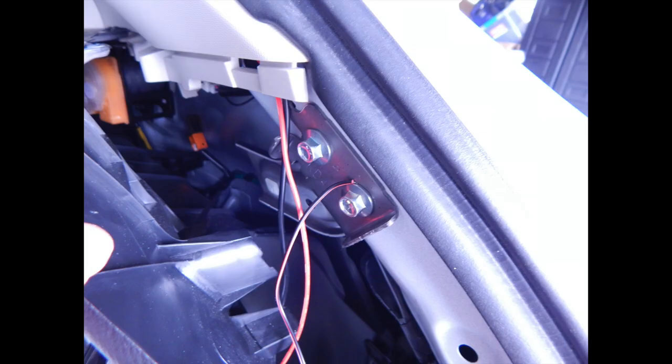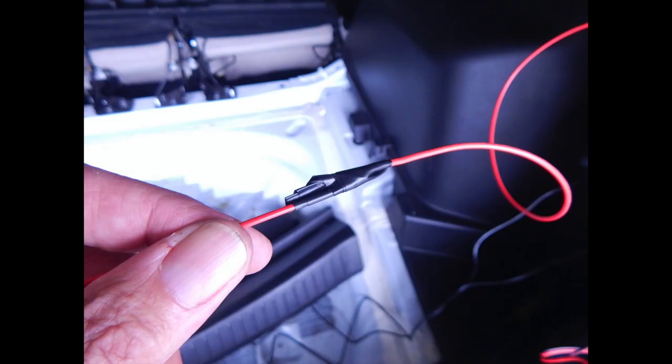You can see where I pulled the wires through that rubber grommet. It's a good idea to put a little silicone seal in there once you've run your wires. I attached the ground wire to the frame or chassis of the car, and at that point I also attached the power wire — the one that runs from the control box — connecting it to the long power line I ran to the backup light.